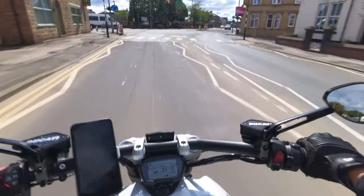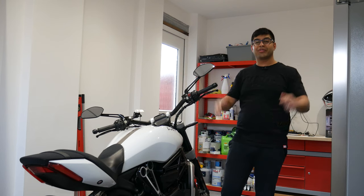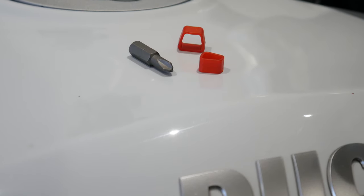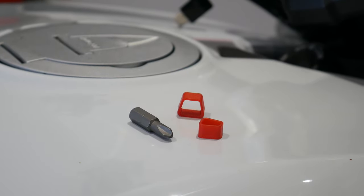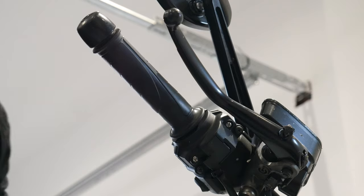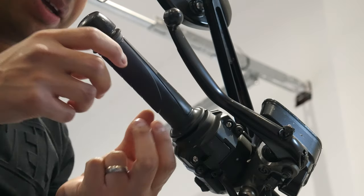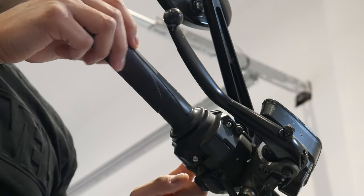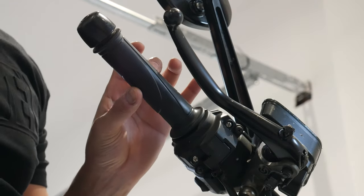What we're going to do today is put on these Ducati spacers, which are a really cheap and easy modification. They don't look like much - they're really tiny little circular plastic nubbins that go inside the gear of the throttle. Here's a close-up of the throttle slack - you can hear it and see that play there. It's about 5mm worth of play in the throttle. The spacers fill in that void in the assembly to get rid of that slack.